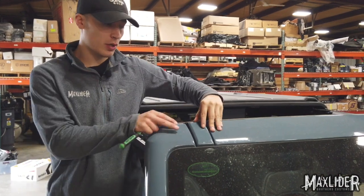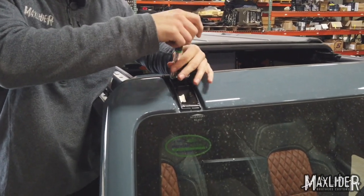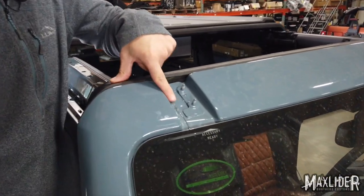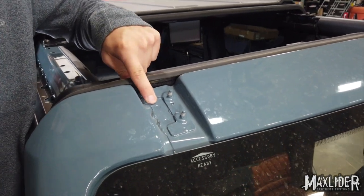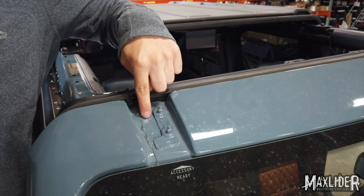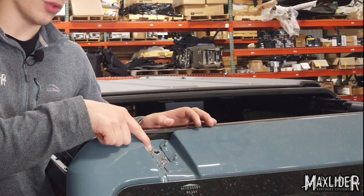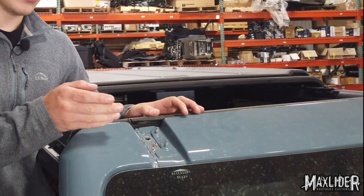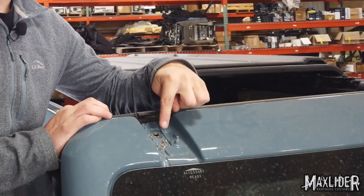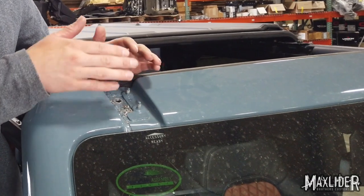These covers hide our windshield light bar mounting provisions, so we're going to remove them. There's a little plastic tab at the top to push in — the painted part comes off and there's two 10 millimeter bolts. Save these for if you ever want to remove your light bar in the future. Underneath this cover we've got two spot welds; we're going to drill through the top one. There's a hole on the inside of the Bronco that lines up with this that we'll run our wires through, and that's also where the hole in the bracket lines up, so make sure to drill out that top spot weld. Use some kind of protective covering on your wires to go through the metal hole you've drilled so it doesn't cut the insulation. We use a 13/32nds hole — that's what fits the wire covering we use. Also make sure to clean up all the metal shavings; use compressed air to blow them out. If you leave them, whenever it gets rain water it'll start to rust and you'll get rust water dripping all over everything.